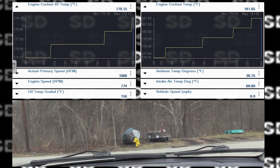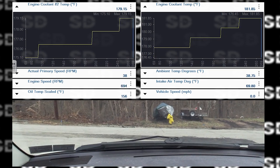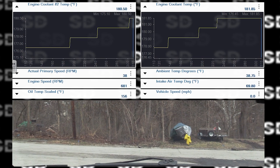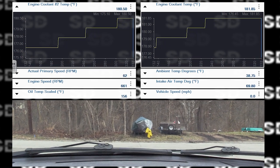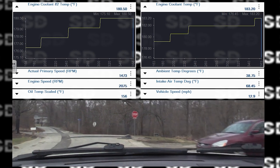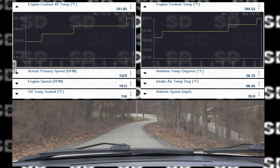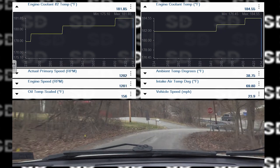One of the things you can do with stuck thermostats is you pull your engine temperature sensor up, and you sit in traffic for a little bit, or sit still with the engine running. You see we're climbing, we're like 180 degrees, still climbing. Then you go for a ride and put constant airflow across the radiator, and we should not get a temperature drop is the point. If this thermostat's doing what it should be doing, we should continue to climb.